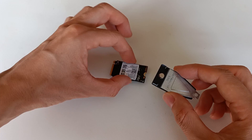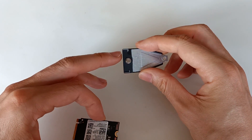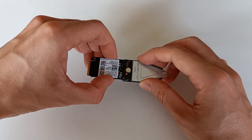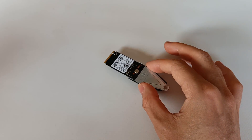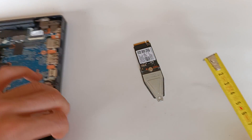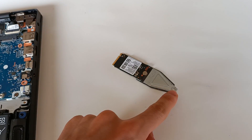To mount this you will have to fit the SSD module into these metal brackets which will hold the module in place and fit perfectly into the hole of the screw. The module is fitted now, and if you measure the length of the module with the extender, it now measures 80 mm and is compatible with the M.2 2280 connection.